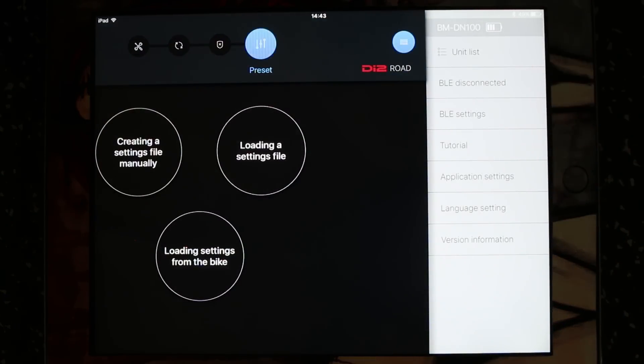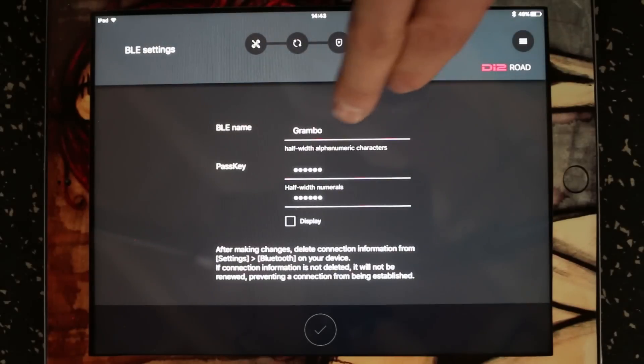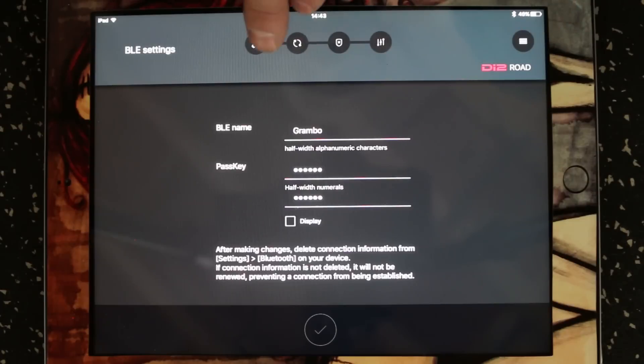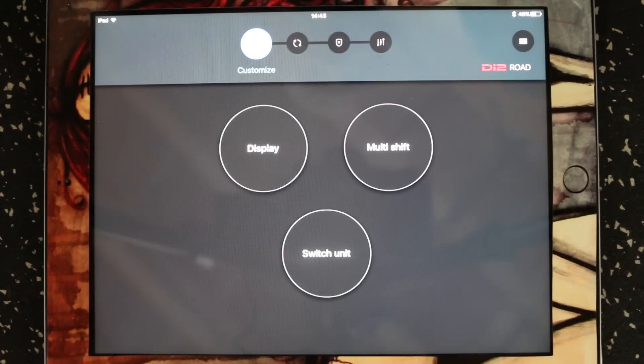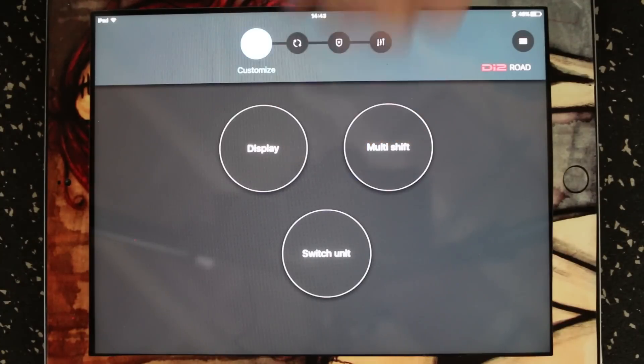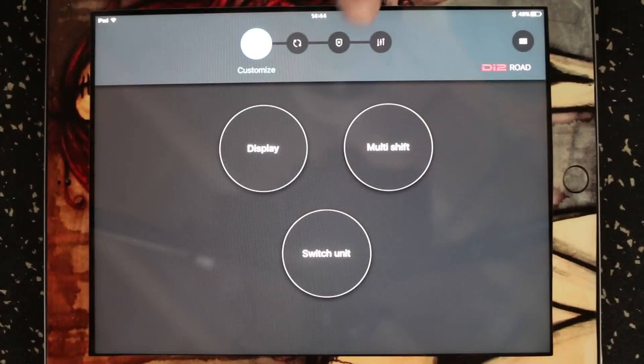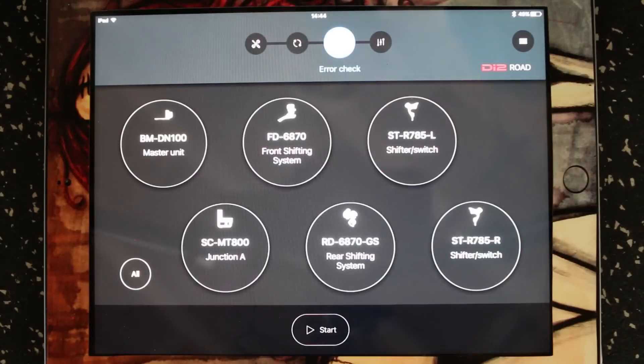Options on the side here let us change the language, the application, take a tutorial, and change the settings for the display itself — the name that it's displaying and its pass key. That's it right now that you can do on the road bike end. Later in the year after Shimano releases their new 9100 Di2, there will be a synchro and a semi-synchro option available for the road bike. If this was hooked to a mountain bike, we would also be able to change the synchro map through this app. If you're using the app on the phone as opposed to a tablet like this, you'll have all these options available except for the error checking option — that's only available on the tablet version of the app or through a PC using the BCR2. There are error checking functions that are only available through the BCR2 as well, so that's going to be the most powerful way to check your bike, but this works pretty well. It's nice and portable and it's something you can easily do at home.